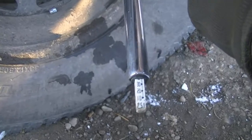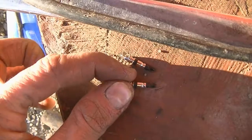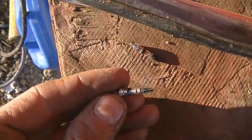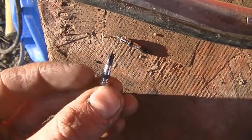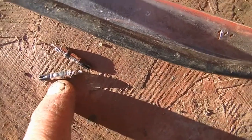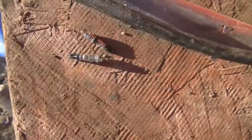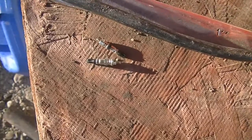It had 38 pounds — that's frustrating. It's these ones with the little plastic nubbins on them. This middle section with the black ring around it is floating, so when you push on it... the top threaded part separates from that part, and if it doesn't seat back 100% properly, you're gonna leak. So I swapped them out for conventional ones, cause you know what, they work.